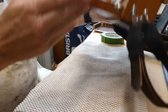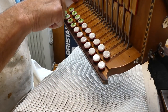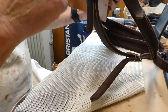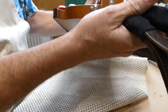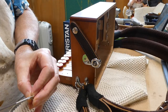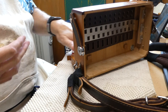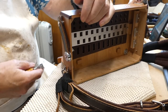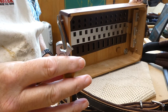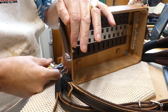What we need to do now — all the mechanism is hinged on a single rod which runs down there, the end of which is covered by this little cover. Now the difficult bit: the rod is under tension from all the springs. If we're lucky it'll come out easily; if we're unlucky it'll be a fight. I use my standard end cutters as the first go.